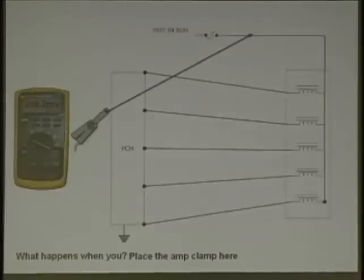Okay. All right? What's that read up there? 3.494. What do you mean? What is that? How many milliamps is there? 3,000. Very good. And 3,000 milliamps is what? How many amps? 3 amps. Remember, because there's 1,000 milliamps. Millivolts, or milliamps, or milliseconds, or milliwatt per volt or amp, whatever range you're in. Does that make sense, everyone?